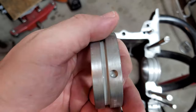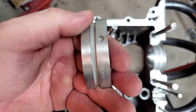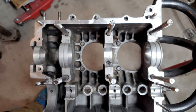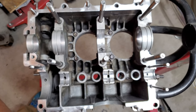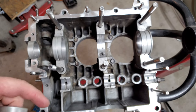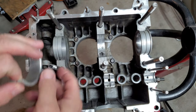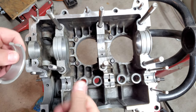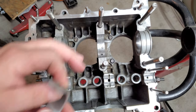So sometimes they don't line up very well and you need to do a little bit of notching to get that to line up the way you want it to. So back to the scoring of the bearing sides. The reason why we're doing this is to assist us in the installation of the crankshaft whenever we go to pop it down in here, and to make sure that it's seated all the way across the bearing surfaces. So we'll go ahead and leave this out for right now because there's no scoring required with this,